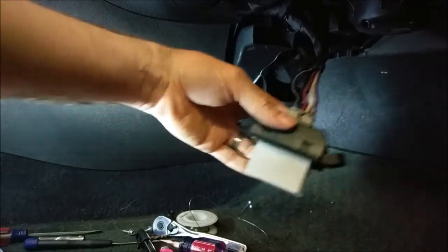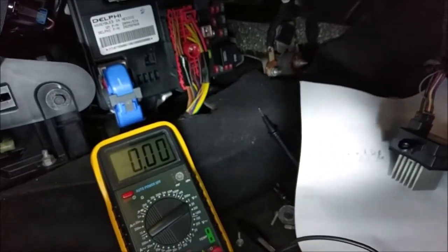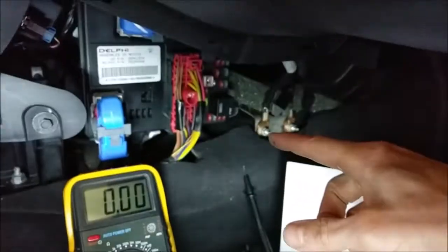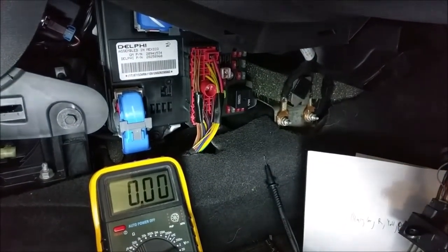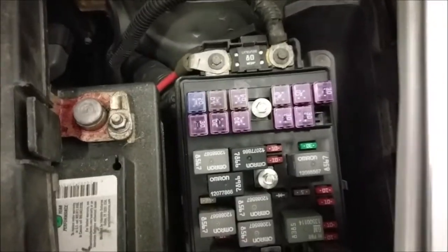Apparently the fan didn't work. The reason why the fan didn't work was I left the key in for one, so it had power. I didn't have 12 volts to ground. The 10 and 20 amp fuse over there had no 12 volts on either side — that tells me the fuse I'm looking for is probably in another panel under the hood. And when I came under the hood, it was this 30 amp maxi fuse right here — this guy was blown. Pop the new one in, good to go. Fan does work now.